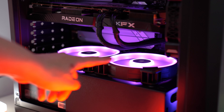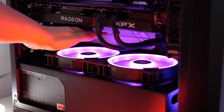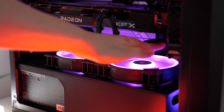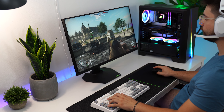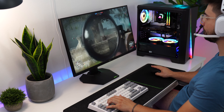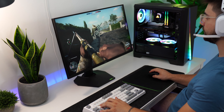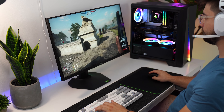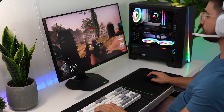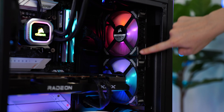For performance: at normal desktop usage, from 12 inches away this was hitting 33.6 decibels. Under load, it goes up to 36.9 decibels after gaming for over 20 minutes, leaving fans in auto mode. This was with four 120mm fans and a 240mm AIO with two fans on the radiator — essentially the same build used across all tests.